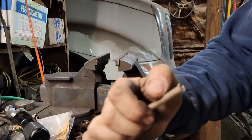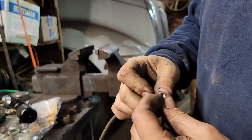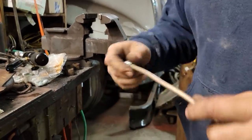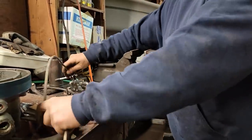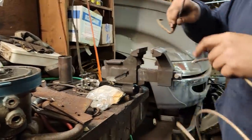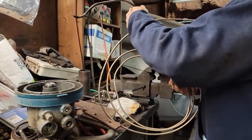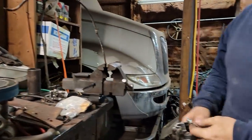There you go - it's pretty perfect. There's a little pinch right here but that'll be okay. And I remembered to put my new ferrule and new nut on first. So what I'll do is flare the ends that are real tight first, then stick the line back in the vise and match the bends.